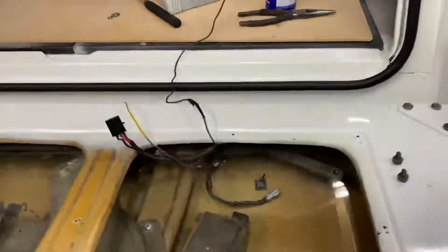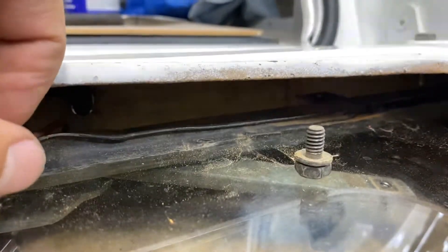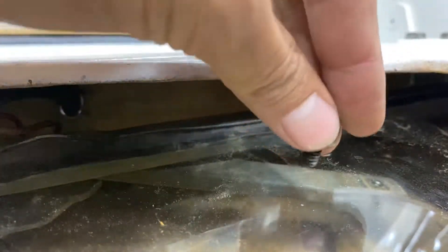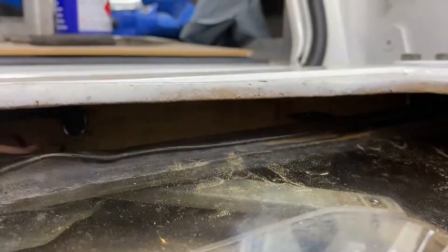After a bit of sitting down and looking at different angles, underneath here you've got the rail that holds the window. There are two bolts holding the rail of the window onto the winder. So just reach under there — mine was size 11 — loosening off two screws, one, two. Move to the other side and there's two under there as well. I'll try and brighten it up so you can see — there it is. So I'm just going to get in there with a size 11 and back that off.